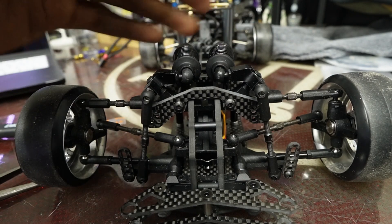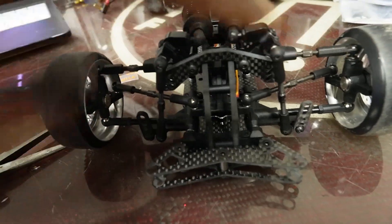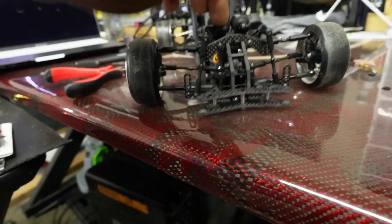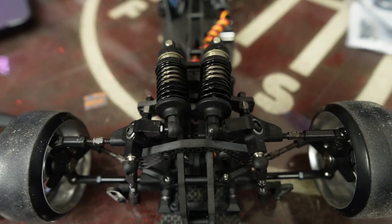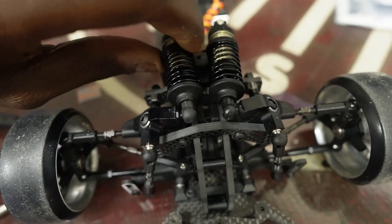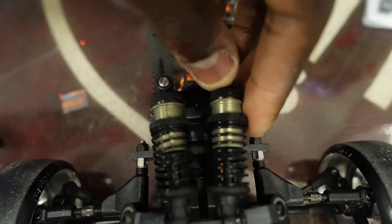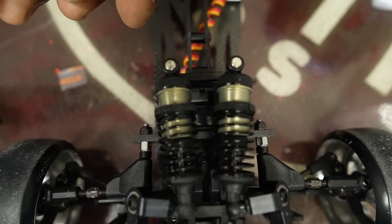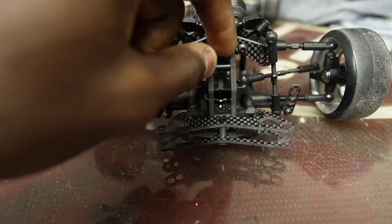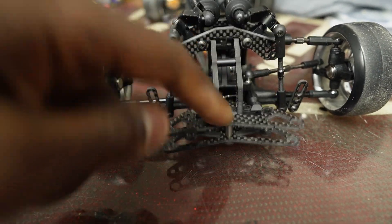Here's the setup right after you've converted — you kept your dampers the same as if they were non-cantilevered, and this is what you end up with. The chassis is pretty much on the table; there's not much bounce and there's a lot of preload I can add. So I'm simply going to start with the damper and twist it about 10 turns — make sure they're equal. That's a really awesome thing about cantilever: you can look from the top and see they're equal. Now that I've done that, we have a nice bounce — back to normal.